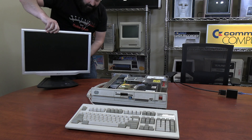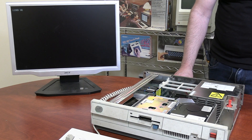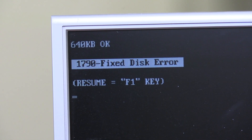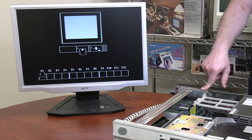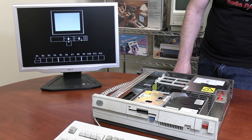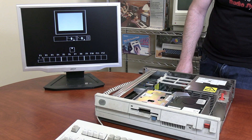We'll get a standard flat panel monitor to test it with. The hard drive's toast — we're going to have to create an original IBM DOS boot disk, but we'll have to find another machine that has a drive capable of writing to that format. We should be able to get this machine to boot up. It passed the memory check okay, so I think we've got a valid test candidate at least.